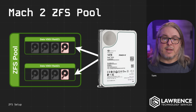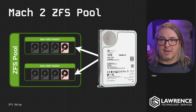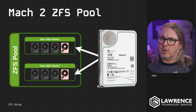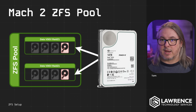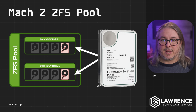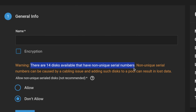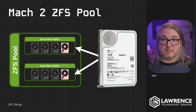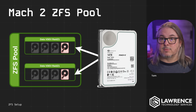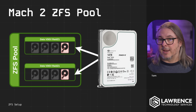What we're doing here is putting each one of these drives — one physical drive — but splitting them into two RAID Z V devs. We're going to be doing this with seven physical drives, giving us a total of 14, seven in each V dev. When we pull out a drive, we will lose a drive out of each of the V devs, but being at RAID Z1, they can survive that. For more production environments, RAID Z2 would be a lot better and RAID Z3 would be most ideal. The problem with doing this inside TrueNAS is TrueNAS uses serial numbers to uniquely identify drives. Even though these have separate SMART statuses for each set of actuators, the drives themselves share a serial number, and this is not currently supported in TrueNAS.